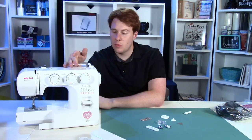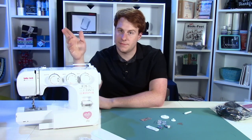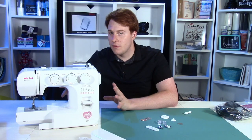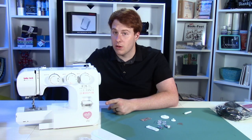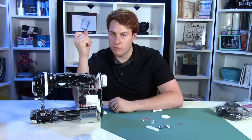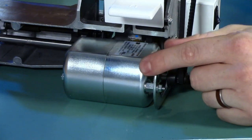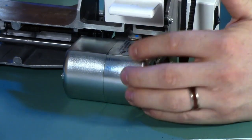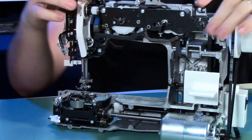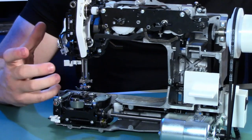The machine does have a bobbin winder right up top here — click it over, wind the bobbin, click it back, and it'll disengage. There are plenty of sewing machines out there with similar features, but we at Montevilla Sewing Centers like this one. One of the big reasons is because on the inside it's got metal components attached to a full metal frame everywhere it counts. The foundation of this machine is a very strong, solid, large motor that transfers all of its torque through a belt into a solid metal drive shaft that runs through the center of the machine and transfers the power down into the needle — all using metal components.